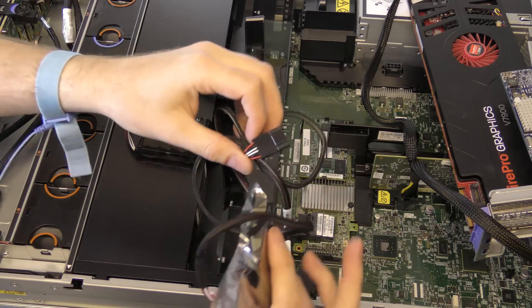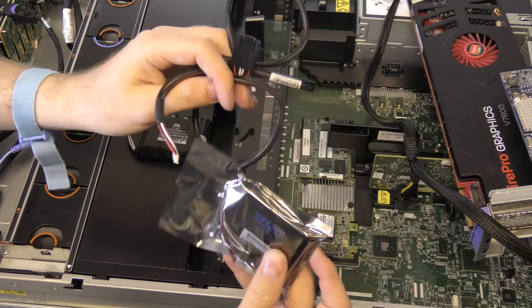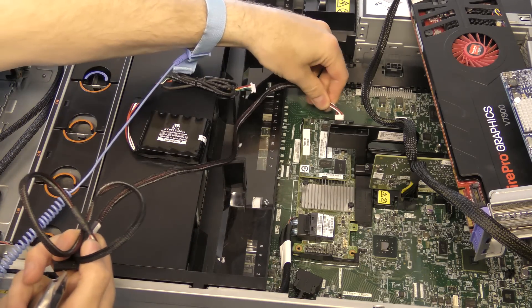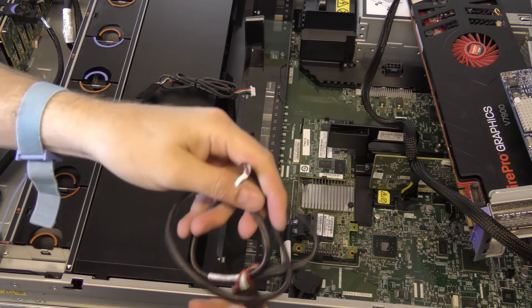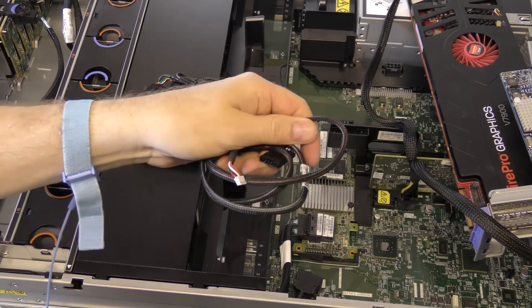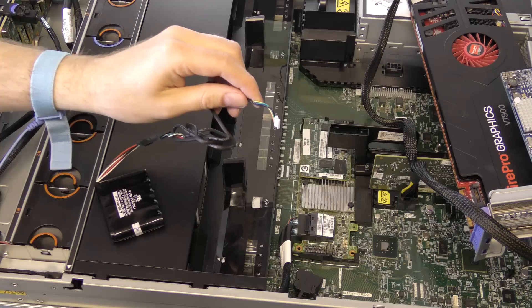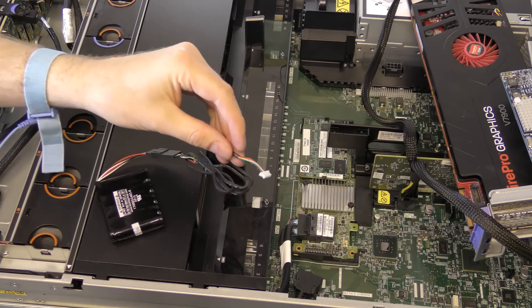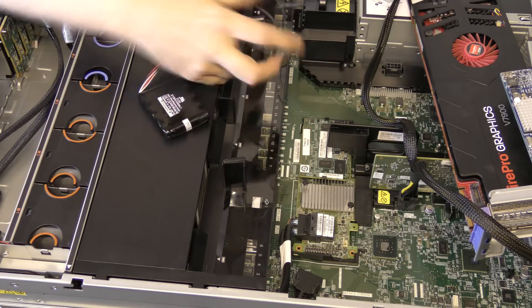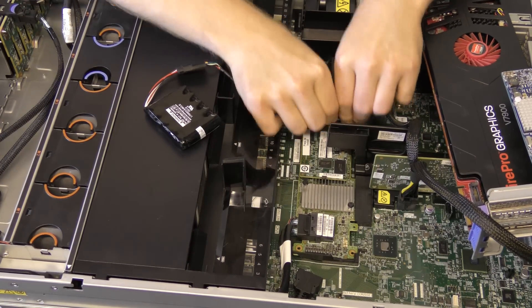That's why we've gone from lithium-ion batteries to a capacitor — 13.5 volt, 6.4 farad. Thank you to my patrons who supported this. Unfortunately I bought the wrong one first: I accidentally bought the one for the M4, which has a white connector that doesn't fit. I had to buy another one with the correct connector. I could have just bought a cable adapter, but I found that out afterwards. All the pictures online showed black connectors, so when mine arrived with a white one I thought they'd sent the wrong item.